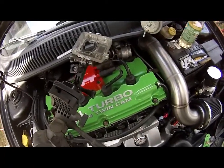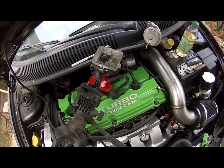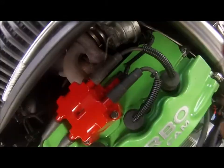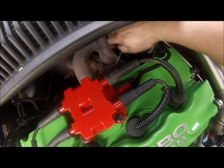There will be 13 millimeter bolts, I believe, rather than 12, but I have 12mm from Hondas so I just put the Honda bolts in and it fits. There are two bolts — one here and one at the bottom.